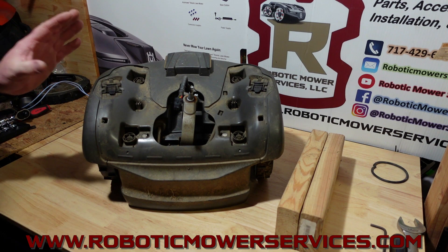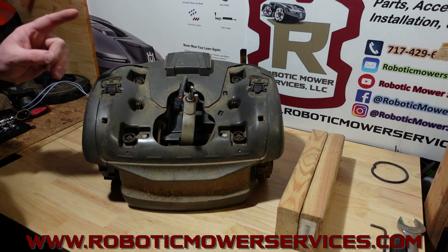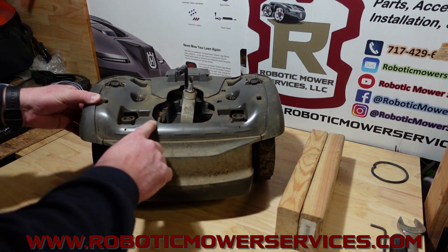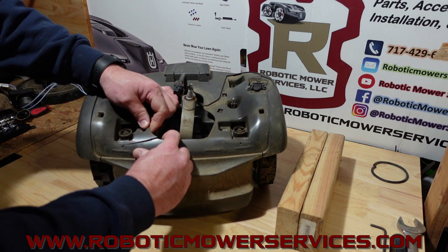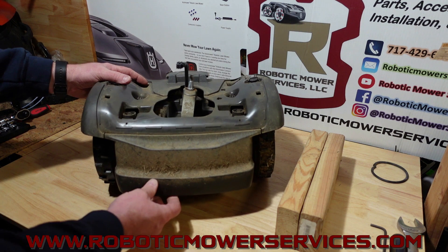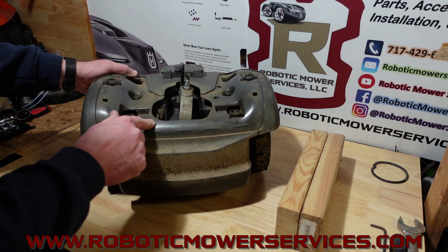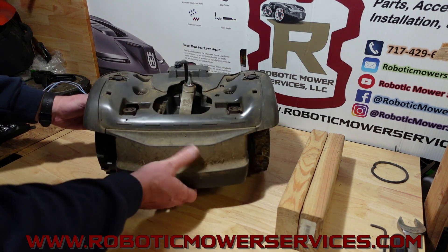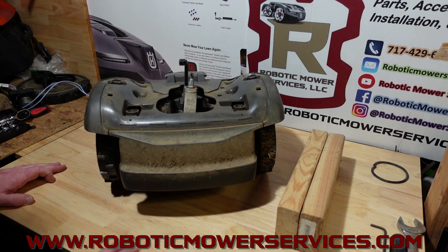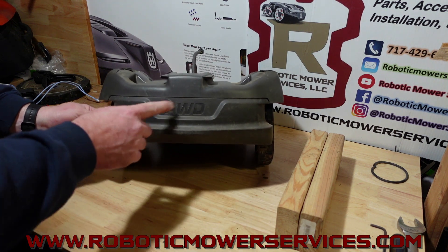The way this comes off is just like any other AutoMower that uses the snap lock caps — you're just going to pull this thing up off of the joysticks. One thing I will warn you about: at the front, this part right here is very vulnerable to breaking. As you can see, this has a big crack right across there — it's already split out and you can see the hairline crack through there — because when this thing's driving it's constantly getting stuck on stuff when it backs up. So when you go to pull this up off of the chassis, don't just grab down here and try to yank up because this whole thing is going to break off.